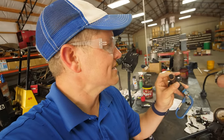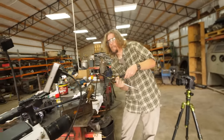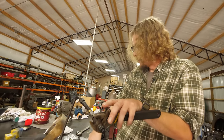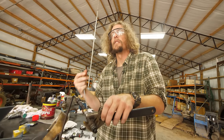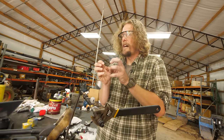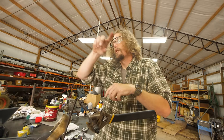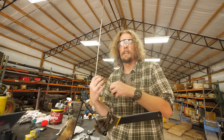So what does an ideal pattern look like on a fuel injector? The ideal pattern is going to be even throughout all of the holes, as you pointed out at the end of the injectors. If you've got four ports on there, you're going to want to see fuel coming out of all four ports. You want it to come out in an almost even burst, where it will be evenly distributed inside the cylinder.